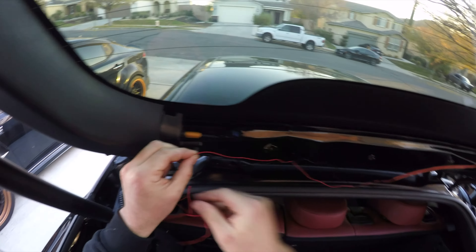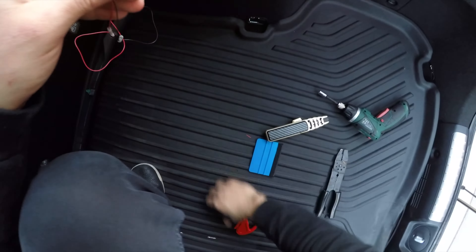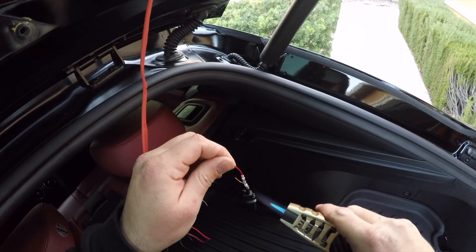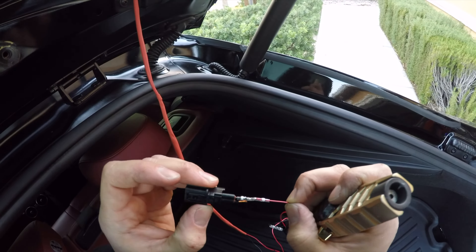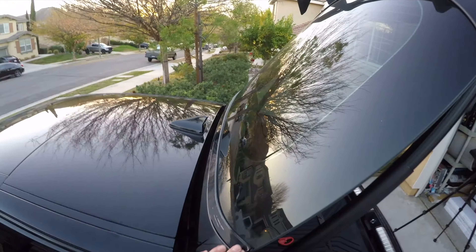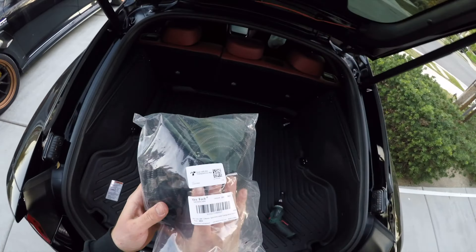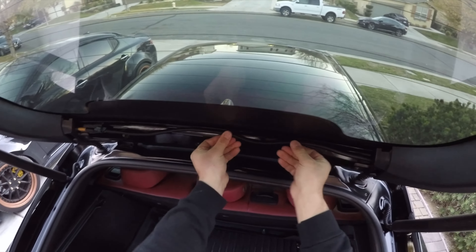Right about here — putting some heat shrink in between both of them. What I like about these is there's a metal piece inside that once it heats up and melts, it makes an even more firm hold. And that's solid. I'm going to double-check to make sure this works — and it works, it's lit! Now just to button everything up, I'm going to put some wire protector on it so it doesn't get cut in the process. Wire loom tubing should do the trick — this looks OEM. Just got to tape this up here and it's good to go.